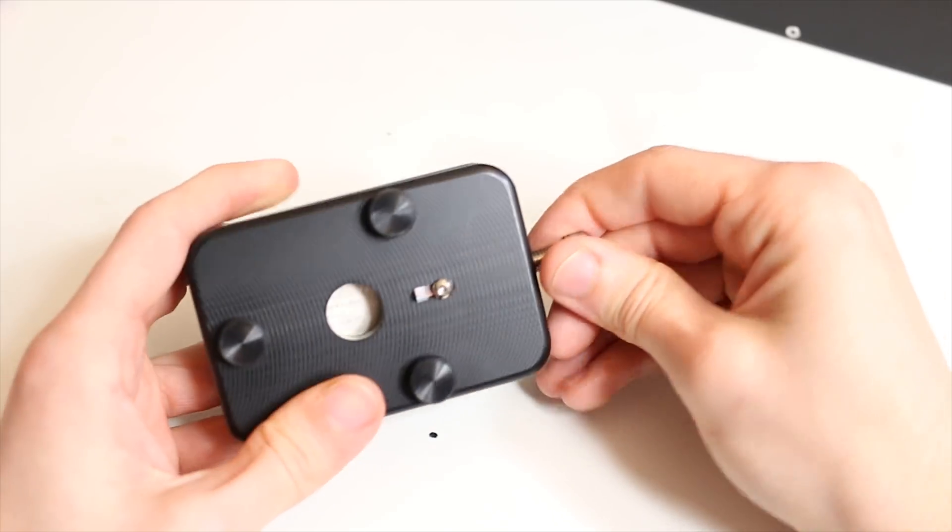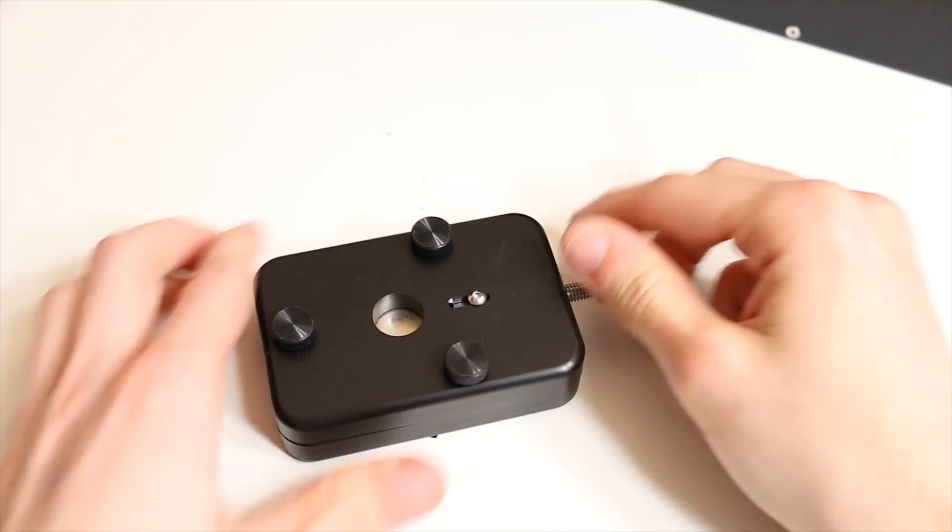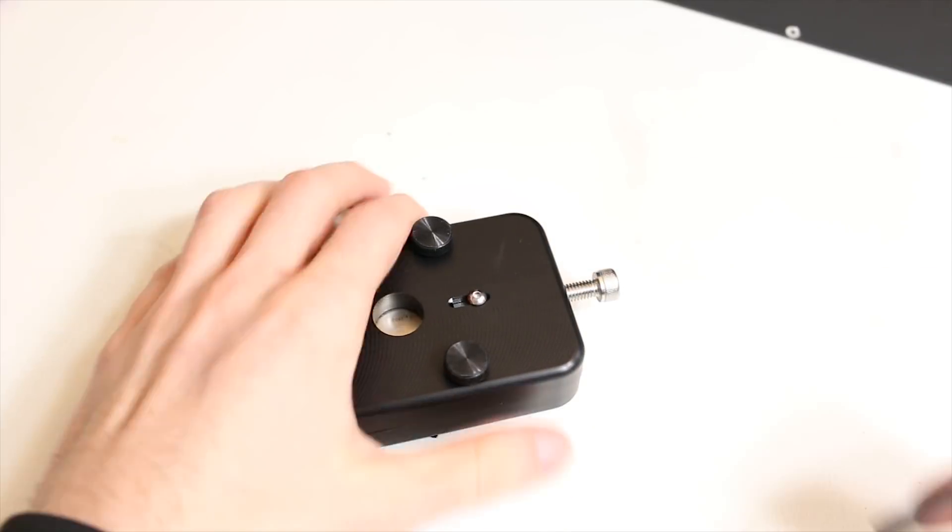What I thought I would do is rip off the lid and put some Thermal Grizzly liquid metal on it and see what temperatures we could get. For that procedure we're using a de-lid tool. This particular de-lid tool was given to me, but they're not incredibly expensive — especially if you're a computer tinkerer. It will handle Ivy Bridge, Haswell, Skylake, Coffee Lake, and Kaby Lake.